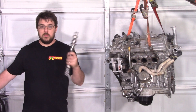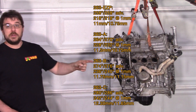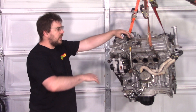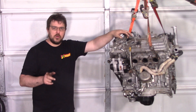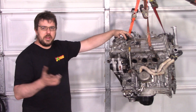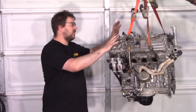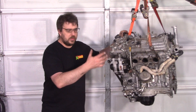These are about 280 degrees or so. The specs show up on screen. The next video on the 2GR will be me taking one of these apart and installing those camshafts, checking for all the clearances and everything. One thing that's already become obvious: the base circle on the Kelford cams is slightly smaller than the factory base circle, even though they are not regrinds. I'm not 100% sure why they did that, but I do have plenty of shims on hand and we'll figure out exactly what it needs in order to run them properly.